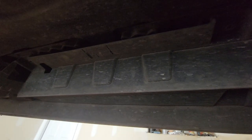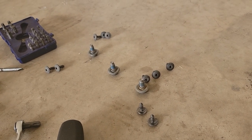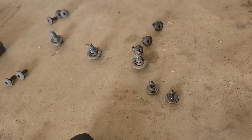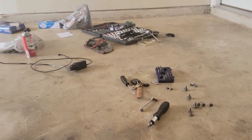One thing to annotate: at the front of the vehicle, there might have been one screw at the front at some point — mine doesn't have it anymore, but worth checking before tugging on everything. For a visual reference: no front screws needed to come out, but you've got three running down each side, two in the back parallel with one another, and then three of the big T45 screws in a triangle shape through the center. Once those are fully removed, you can slide the splash guard back and get your oil catch can underneath.